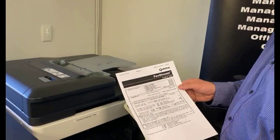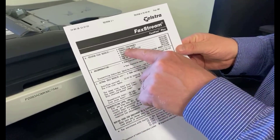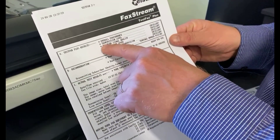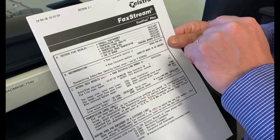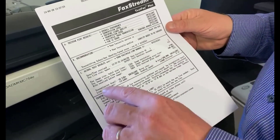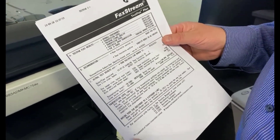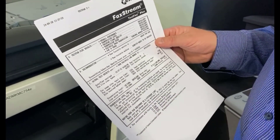So what I've got here from Telstra — this is for Australia but I'm sure there's something similar in your country — is a fax transmission report which rates the connection as excellent, good, or poor depending on the level. What we want to see is that the transmission level should be excellent. Quite often I've seen it come up with a poor transmission level, and further down in the report we can see the transmission level, which should be between 15 and 17. If it's too low, I'm going to show you how to adjust that, because this transmission level is the cause of 85% of all fax problems.